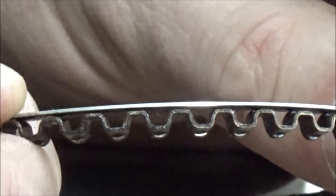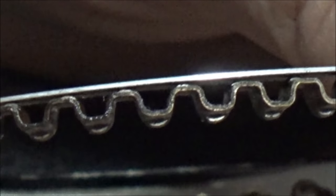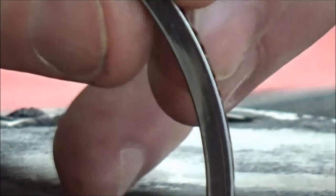If the rail is allowed to go on top, it's going to make an overall thickness much thicker, and it's going to wedge and lock into the piston. Notice how the backside of the expander ring disappears because the rail is on top of it. This would be incorrect.